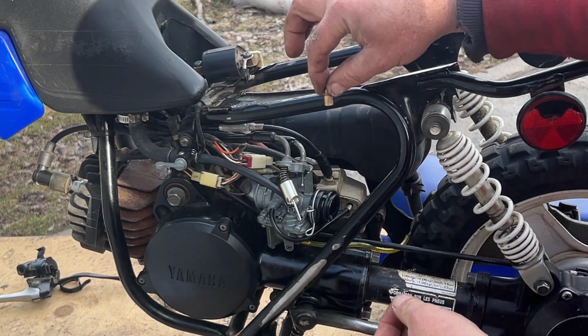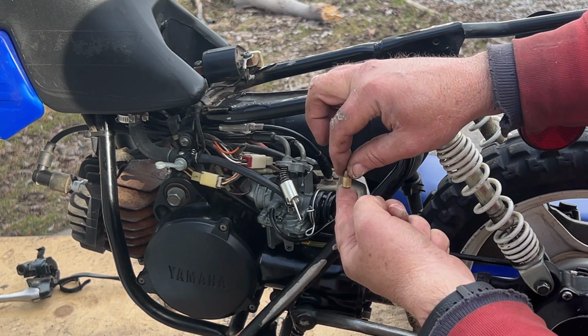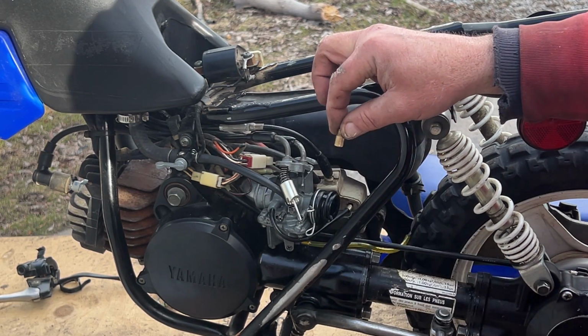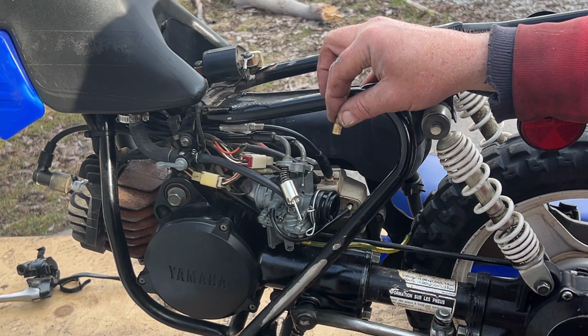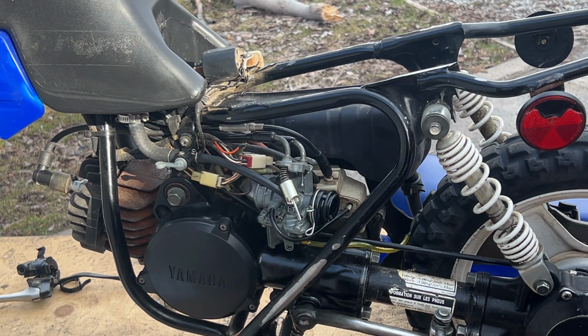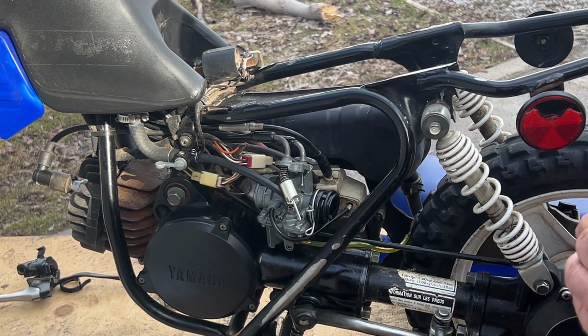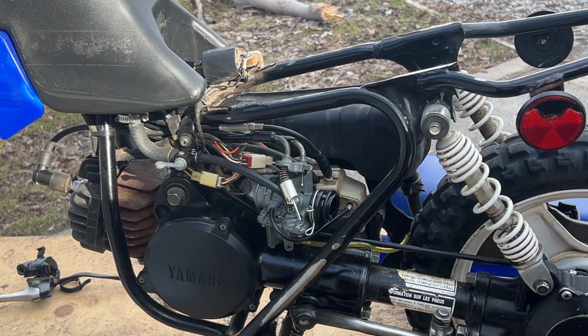So all this little plunger does is when it's down, it blocks off a fuel port that comes in the side. And when you pull the choke, it pops up and lets the fuel come through. So someone thought this was over-fueling at some point, I would think. Yeah, there's no way there would be 2 springs in there. That's not the way we do stuff. Let me get these 2 springs untangled. I'll be back in a second.